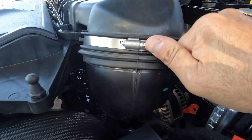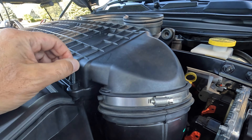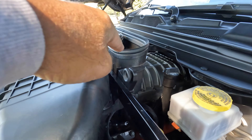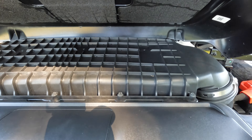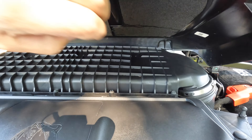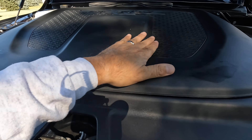Check the side that goes into the engine side when you get the box off and you're able to check under there. Mine was actually a little on the loose side, so I'm glad I caught it and was able to tighten it up. Another piece of advice: when you put your screws back in or take them out, hang on to them. On the back side I dropped one — guys, it went down sitting on the head of the engine. I had to take the whole thing out to fish out my screw with a tiny little magnet. Let my mistake be a lesson learned for you. Hang on to those screws, especially the ones on the back side — when they fall down in there, it's like Plinko and you may not ever see it again. Once you've got all of your 10 screws buttoned up, go ahead and put your cover on. Push it in the back holes first, push it towards the windshield, and then put it on.